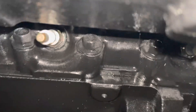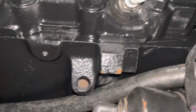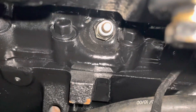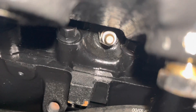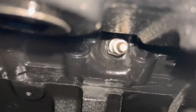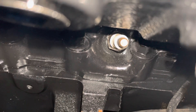There's three, there's five, and let's see what's special about seven. Seven is right there. Seven might be hard because you've got this boss right here for this drain, and that may be interfering with the ability to get a wrench on it. But it looks like it might not be as bad as I thought. Next I'm going to try to put a spark plug wire on it and see how much clearance I have to do that.